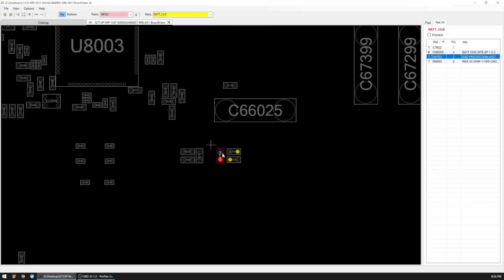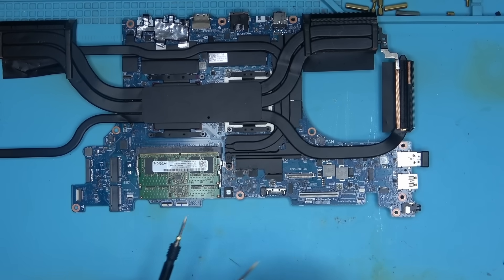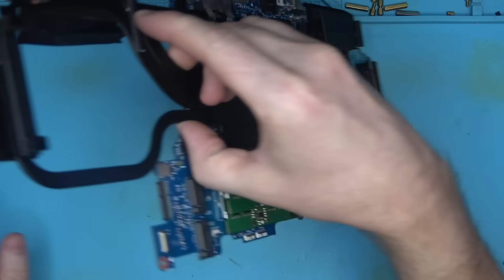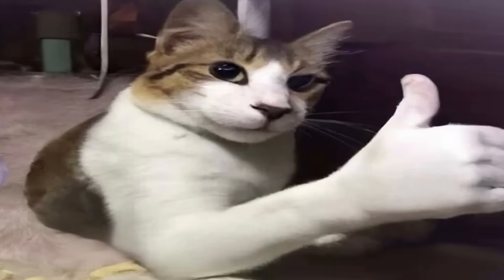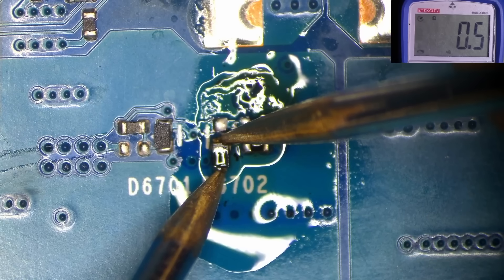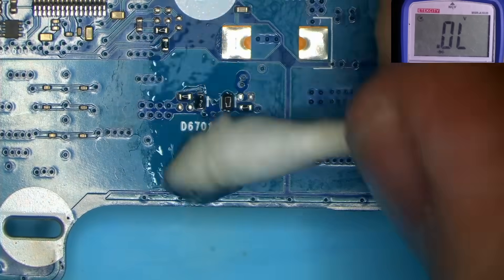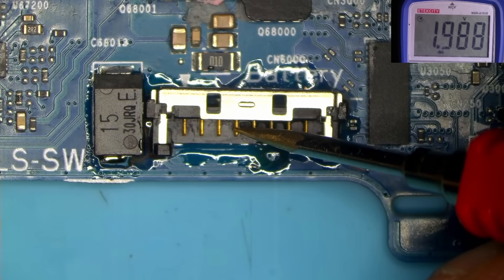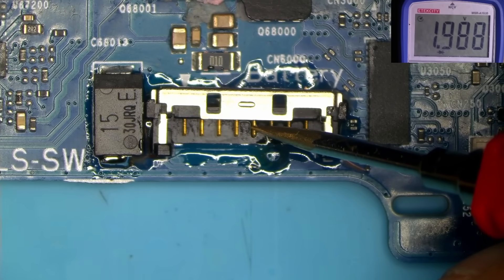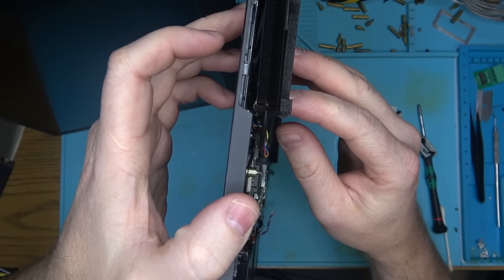According to the diagram, there's an ESD diode soldered to protect either the battery or the board from electrostatic shock. I removed the diode and the short is gone — so the diode was shorted. I don't have that same type of diode, so I'll just replace it with whatever I can find laying around. Now both clock and data pins read the same voltage drop, so let's see if the laptop works. And nope — still no power. Bummer.